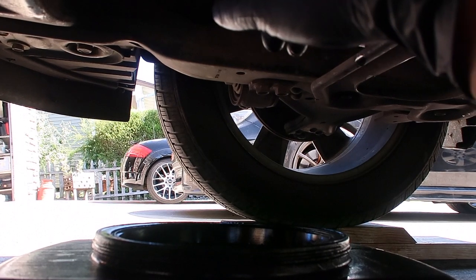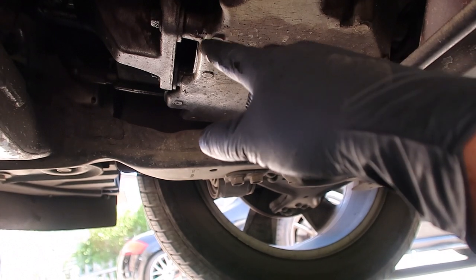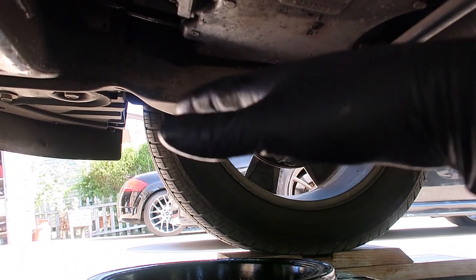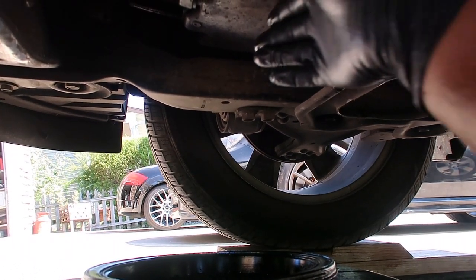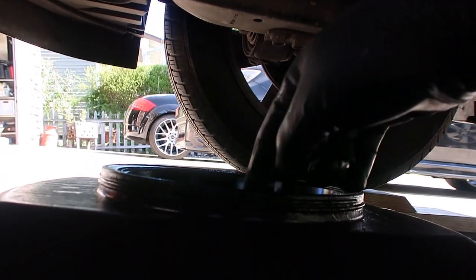I can move it back a little bit and make sure you're lined up side to side. That way I can start it, crack the oil filter open, come down here and make sure we're getting oil into our pan and adjust accordingly. Make sure you have your extra rag available so that you can stop it and hold the oil back to where it will actually drip and make it into the pan.